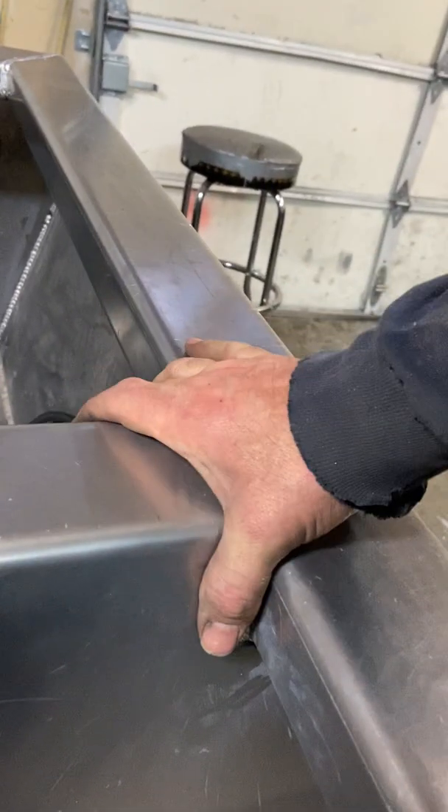These are kind of visual spots and high strength. I don't like putting a weld right in the middle of the big side, so I put a weld down here towards the bottom because it's close to the bottom plate, and then I also put one up here where there's a bend in the side — just a short inch-and-a-half to two-inch weld there. RS Racecraft does something similar — they don't weld it completely down the side because there's no real use to that and you'll get a weld crease dimple. There's a little bit right there that I can feel, but I don't have a big dimple going right across the big side.